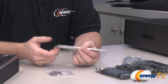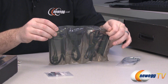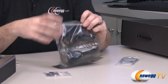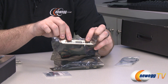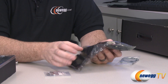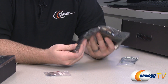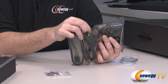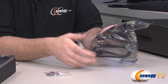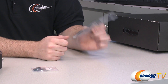You also have a rear panel I/O shield with electromagnetic shielding on the back. There's also an eSATA kit that Gigabyte includes — a PCI bracket with a Molex plug and a couple eSATA plugs. The Molex plug connects via an internal header to your power supply, giving you two Molex plugs or two serial ATA power connectors. You also get eSATA-to-regular-SATA cables so you can route a couple of hard drives and plug them into the motherboard directly.